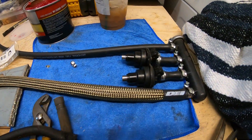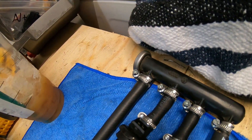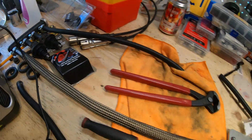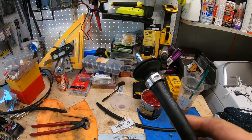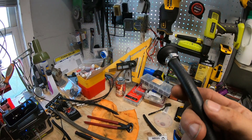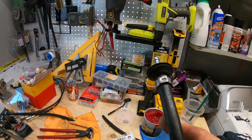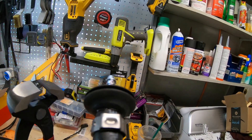I'm using two different styles of clamps. Right here are the stainless steel worm clamps, or band clamps, supplied with the Vanagon kit — I have them on all of my fittings and junctions. Go Westy actually supplies the German-style crimp. The school of thought is these are supposed to be superior, but I'm not entirely sure if that's true. I know while I worked for Mercedes-Benz, these were definitely on every single fuel line. But if you were to use these crimp clamps, you need a special crimping tool.